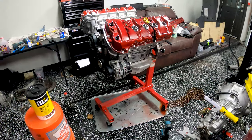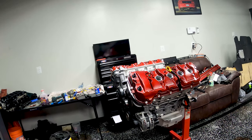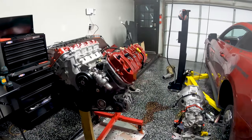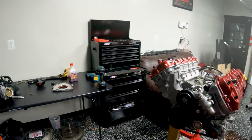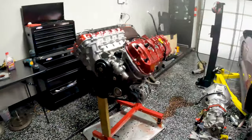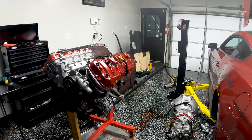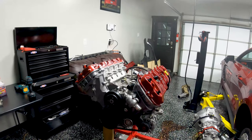Nearing the end — next is doing the motor mounts, which are 41 foot-pounds of torque on the motor mount bolts. That's going to do it for this video. Next up we're going to put the rear plate back on the engine, lift it off the stand, put it on the k-member, reattach the clutch and flywheel, put the transmission on, and then prep it for going back into the car. I'll make another video walking through all that. If you have any questions or comments, drop them below — thanks for watching!